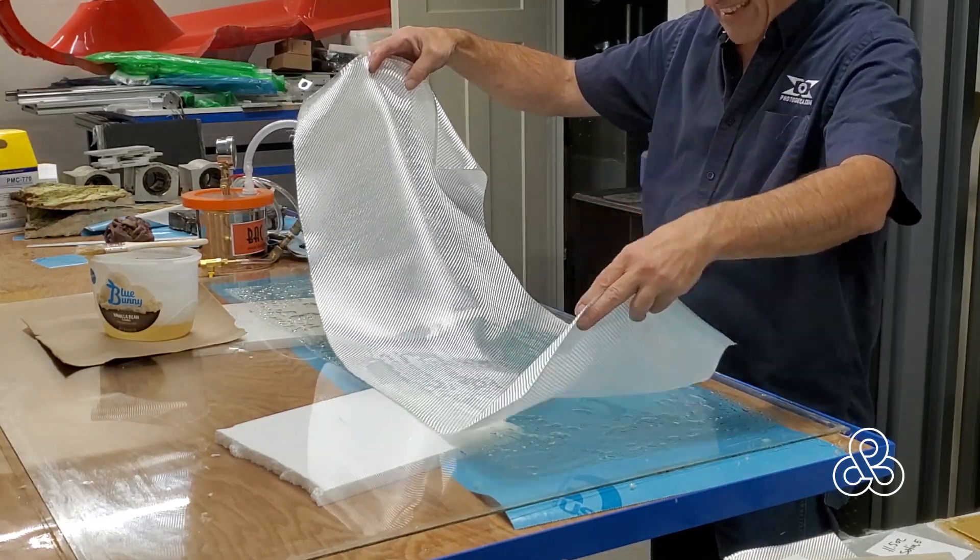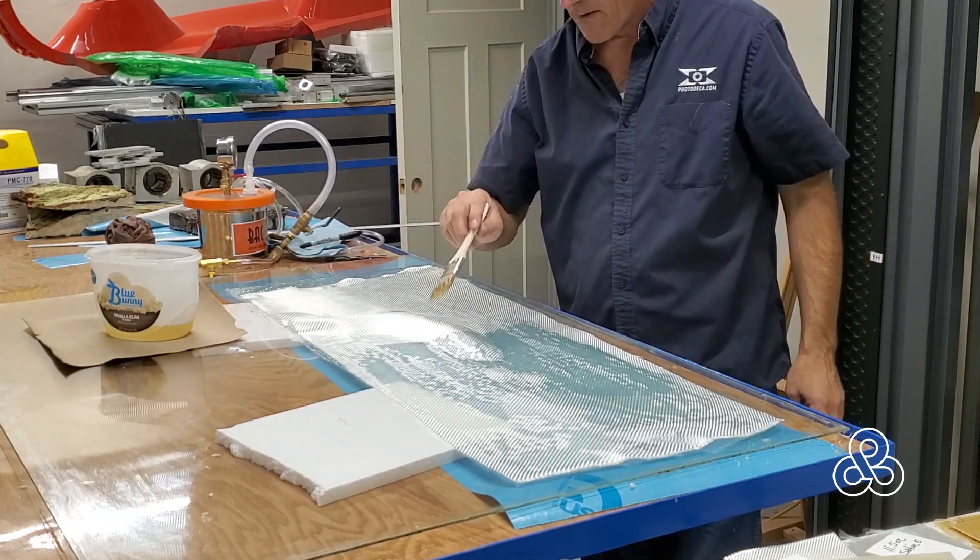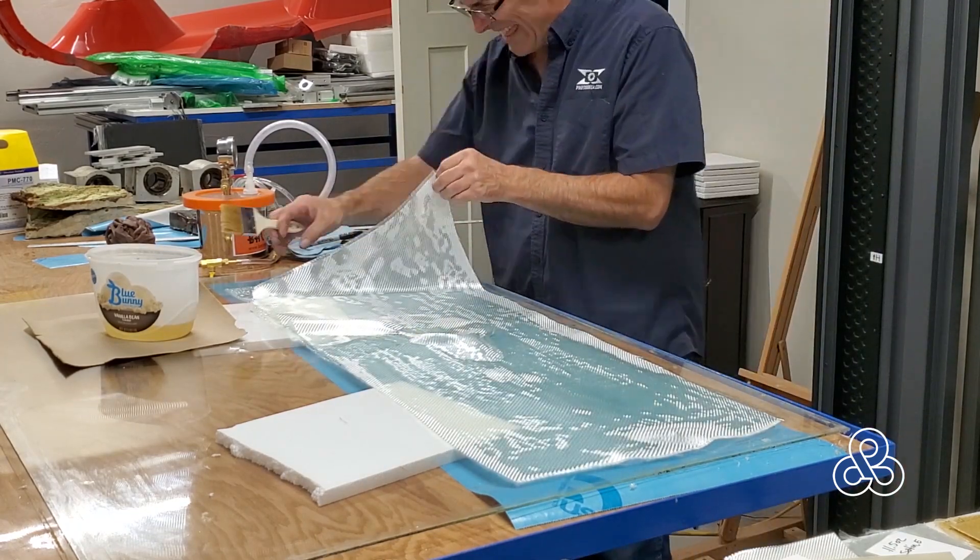We've added a few auxiliary items to stiffen it up and provide protection for components in the engine compartment. Now that it's out of the mold, we're going to drill it for the hinges so we can mount it to the tub and check clearances on all our components. But before we pull it out, we're going to add some inserts to create a wheel well within the clamshell.